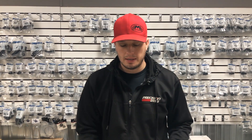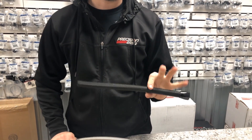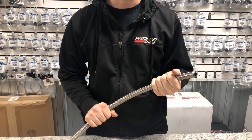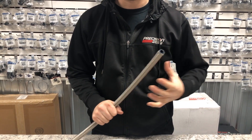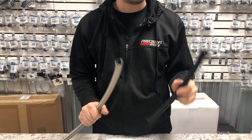I always try to stay away from PTFE hose when I can, but there are instances where you need it. Both hose types hold up to E85 and oxygenated fuel, but the nylon requires a bit more drainage and maintenance. On an oil feed line, with the extremely hot oil from a turbocharger — a number 4 or number 6 style oil feed — nylon hose can actually melt and become gummy. It'll rotate inside the fitting and start leaking at the turbo inlet. In that instance, PTFE hose is definitely needed. PTFE holds up much stronger to heat and extreme circumstances than nylon does.